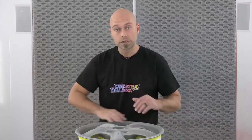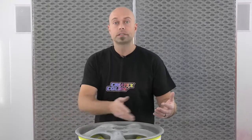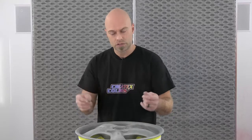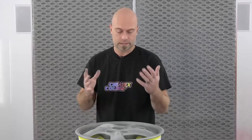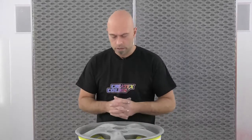Once that's all done, I gave this another rinse and I wiped it down with a water based degreaser because it's a water based scuff paste that I used. It helps break any residue that was left behind, any of that sanding sludge. The water based cleaner is a PPG product — the PPG SX 394, that's the new version of it. Water based cleaner, wipe it all down with a nice clean lint free cloth and now we're going to talk about the finish.